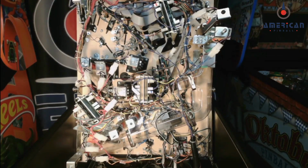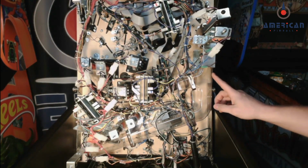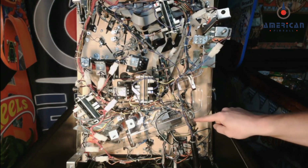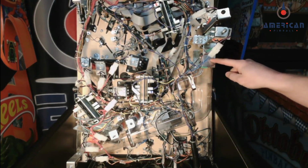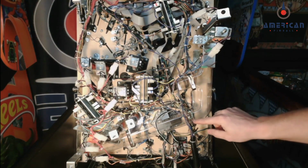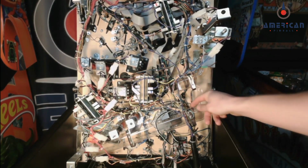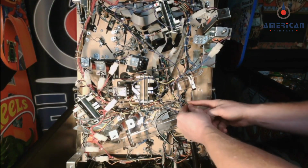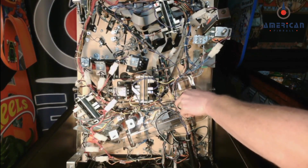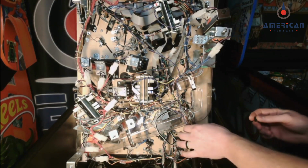Now for the task of getting at the servo itself. The biggest part is removing the subway here, and you'll see that there are some U-shaped brackets that have some optos attached. Since these are riveted to the subway, the easiest way to get these off is there's a metal clip retaining bracket that slides over the opto, and you can just pull the opto off. It just clips in there, and you can do this for both sides.